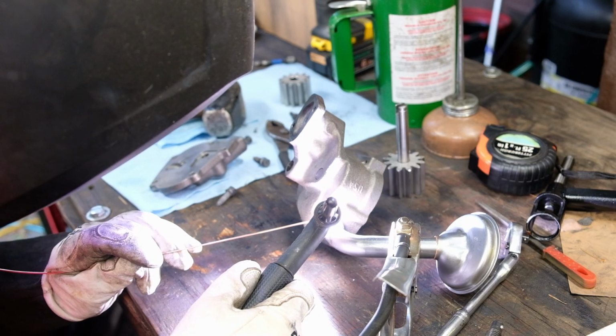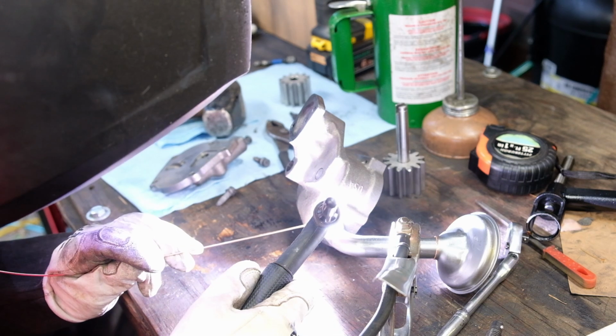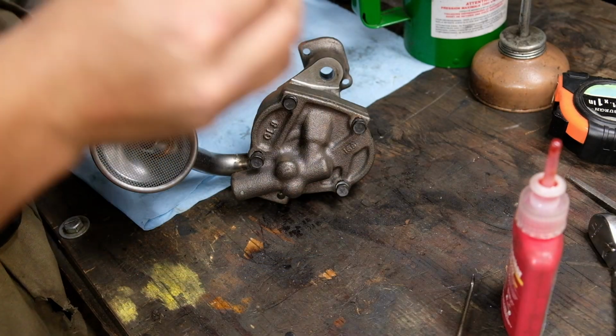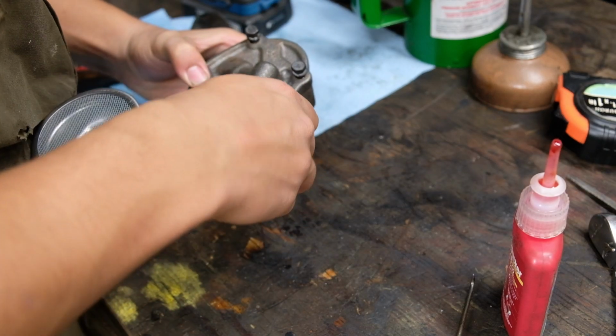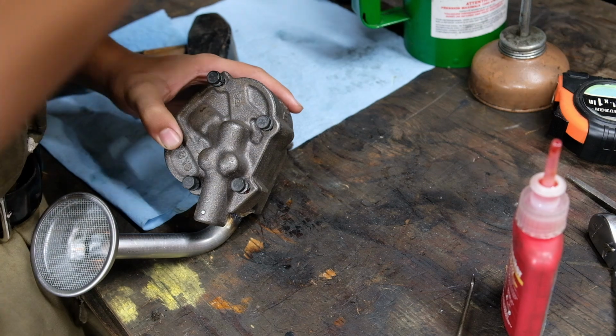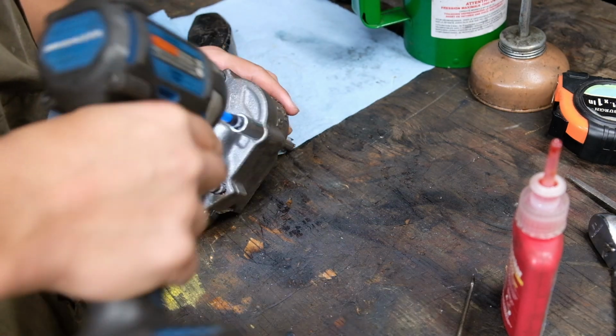Back during that first engine test, even with a thick SAE 30 on a cold start, my oil pressure was mediocre at best. While I had gone through the bearings back then, and I'll certainly be doing it now, I figured I might as well toss a high volume oil pump in there too.